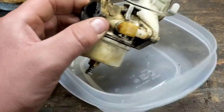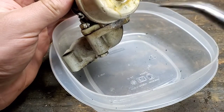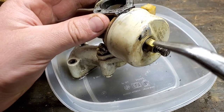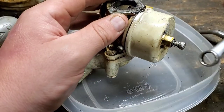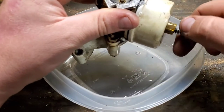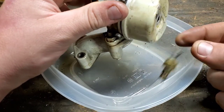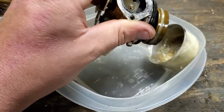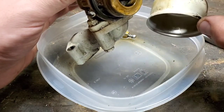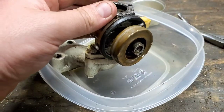Okie doke. So it looks like somebody may have tried cleaning that carb once before — the bottom of the bowl was all pushed in, but fresh brass, so that's a rebuild kit. Looks like they put it in with a vice grip, that's always lovely. The gas coming out is yellow — that's not good either. Look at that float. There's all sorts of sediment in there, that's always great. That bowl is junk. That float — want to guess if it's had water in it before?